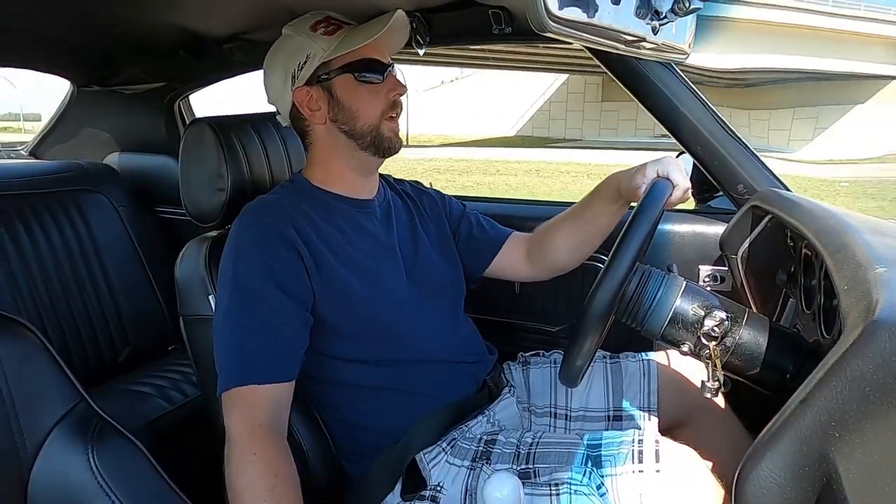Even though the gear whine is still there, it is a lot quieter, so I guess that's a good thing. Unfortunately it's one of those things I think I'm just going to have to live with, at least for now. If any of you have done diffs, take a look at our pattern — is there anything I can do, or anything you can see that would indicate a noisy gear? If any of you have a US Gear, particularly the Lightning Series, let me know in the comments if it's noisy for you. That's now two different US Gear sets for me, and both have been noisy. Quite strange if you have to set them up absolutely perfectly to get a quiet gear.